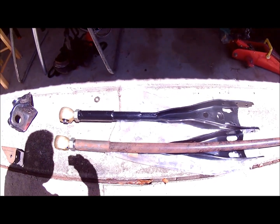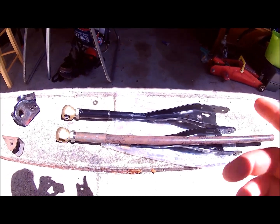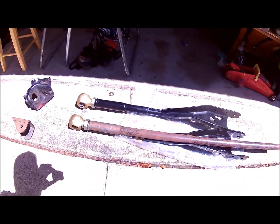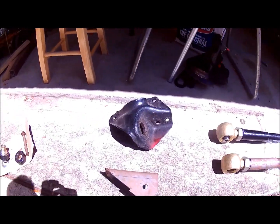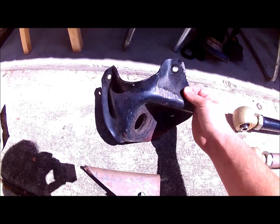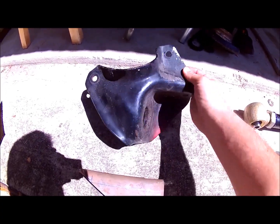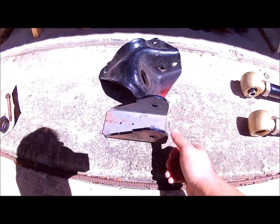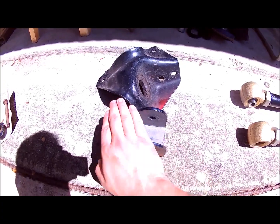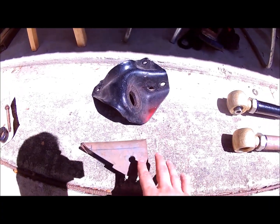What's going on everybody? Before I get too far in this project, I want to point out some differences between the stock radius arm and the extended one that I'm building. These are stock radius arm brackets — you don't get a whole lot of flex out of them. They're alright, kind of thin metal. These are the rough stuff brackets I'm going with: pretty thick, and they even have a gusset that goes in the middle, with a whole lot more clearance in general.